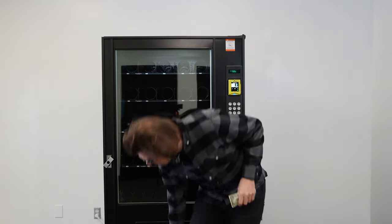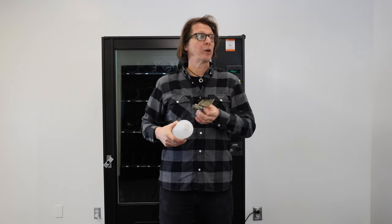All we're going to need is simply a dollar bill. If you have a vending machine, you should have a dollar bill readily available if you're accepting cash. The other thing we're going to need is some rubbing alcohol — this is 91% isopropyl rubbing alcohol. Make sure you get rubbing alcohol with no aloe added and no coloring — just strictly rubbing alcohol. We're simply going to pour it onto the dollar bill so it ends up wet and feed the dollar bill into the bill acceptor. We'll do that 10 to 15 times and it'll begin to pull that dirt off and clean the heads.